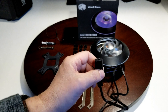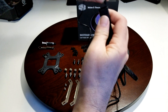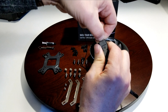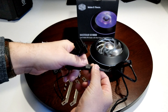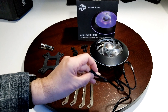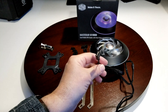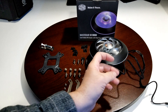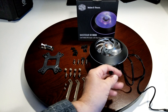If you're going to use the standalone controller, this connector goes in here on the end — line it up and push it in. This will be controlled with a Molex. If you have a motherboard with RGB, you don't need any of this — set that aside and plug it into your RGB header on your motherboard. If you don't have or want RGB, just tidy up the cable and use the 4-pin connector, connecting that to your CPU fan header on your motherboard.